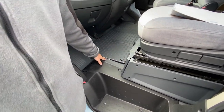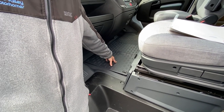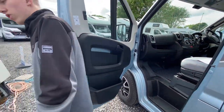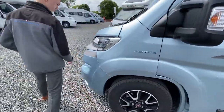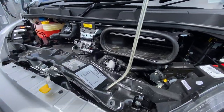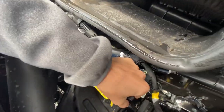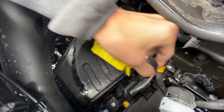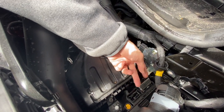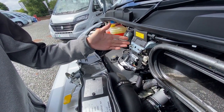Underneath the floor is your engine battery — being a Fiat, the engine battery lives under the floor — but there is a jump point underneath the bonnet for giving or receiving a jump start. Open your bonnet just here; the secondary catch is directly above the Elddis badge. You do have your positive jump start terminal: put your key or a screwdriver onto this cover and lift it up — that is where your positive lead would go. Your red jump start lead goes on there, and your earth is here in the centre of the bonnet.